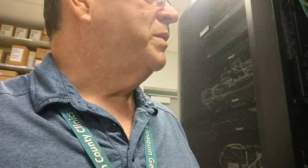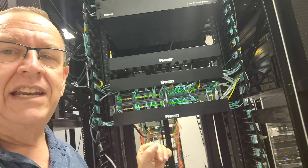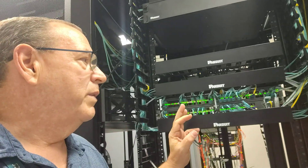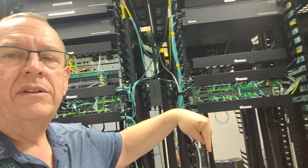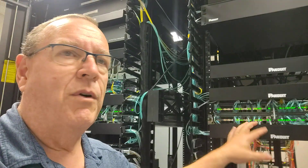The other type of switch we have here is what we use as our core switches. The model number is a VSP 8404. All SFP connections — this is basically one of our four core switches. We have another one right here. We've got a mate in the basement for each one, and we attach the edge switches down there — one leg of fiber goes to this switch and one leg goes to the one in the basement, setting up a multi-linked trunk to those two switches.